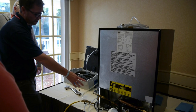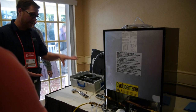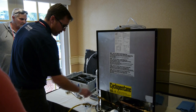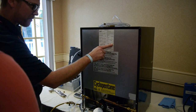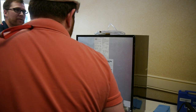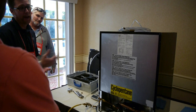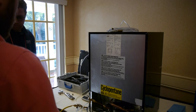One thing you don't want to do: don't turn the scale on with the bottle already on top. Because it's so sensitive in scale range, as you're depleting the refrigerant you can go out of range. Always turn it on first, then place your bottle on the scale, and zero it out — push the tare button. On the back of this refrigerator it says 21 grams, 0.74 ounces. The expectation is the vacuum will pull about half of that volume in — so I'll be looking for anywhere around 10 to 11 grams initially, which the vacuum will pull in without a problem.